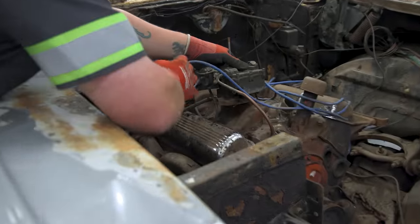It is tomorrow - the next day. We just checked the block casting numbers on this 283. It's got casting number 3789935, which was built from 1961 to 1964. So what that tells us is this is not the original engine. It's valueless and we're going to throw it away, put it out in the scrap bin, and get back to work getting the rear end and a few other odds and ends set in this car. Technically we have three days left including today.